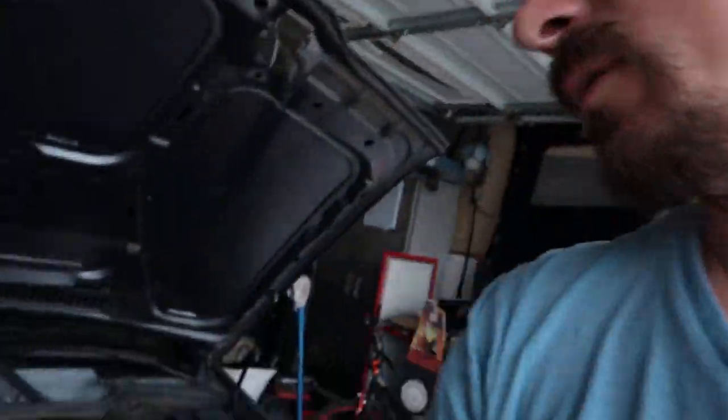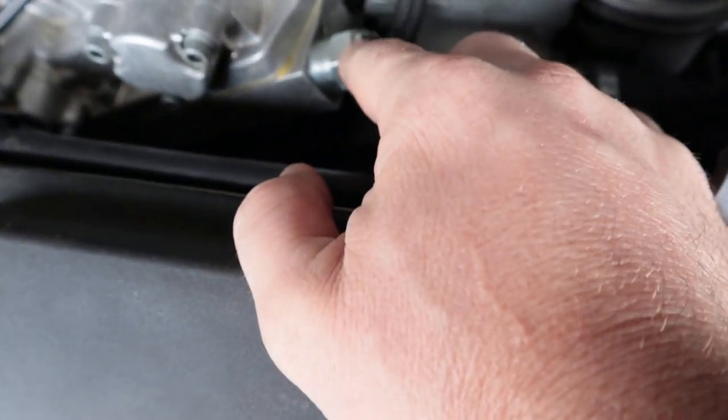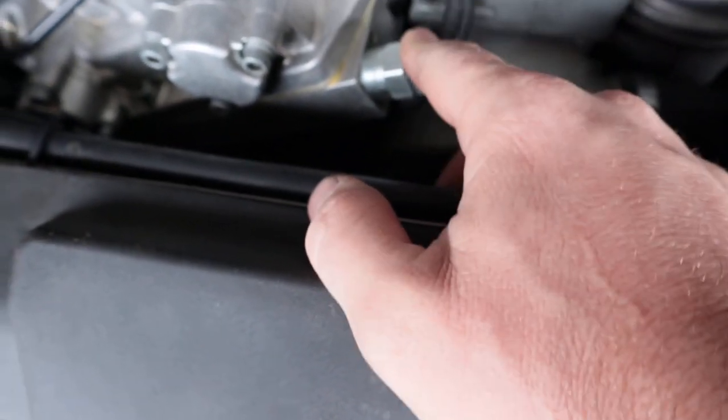Then all of a sudden something went wrong. I think what happened is I forgot to connect my solenoid pack for the Vanos. That solenoid sends oil to the Vanos at certain RPM and adjusts the timing as the engine runs. Since the solenoid was disconnected, there was no oil going into the Vanos, which messed up the timing — and I think that's what happened.